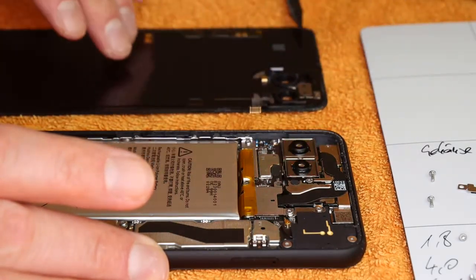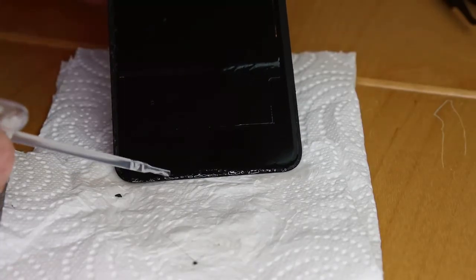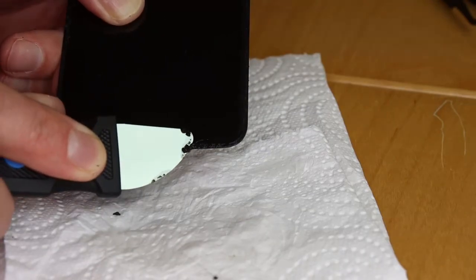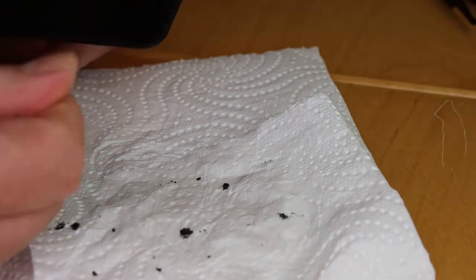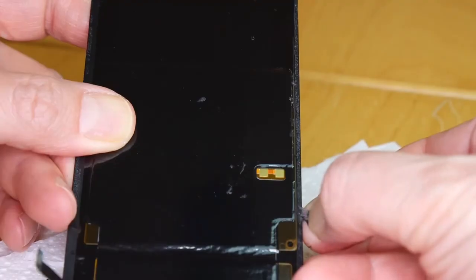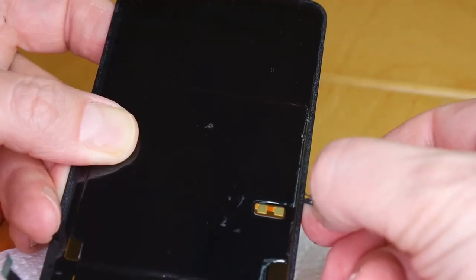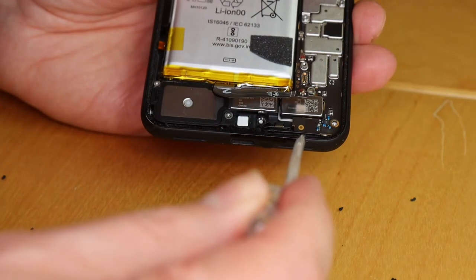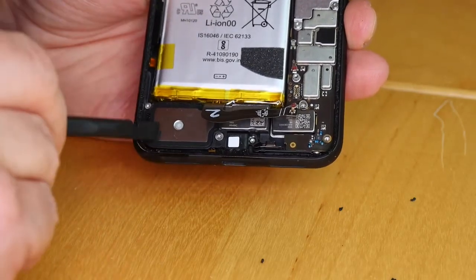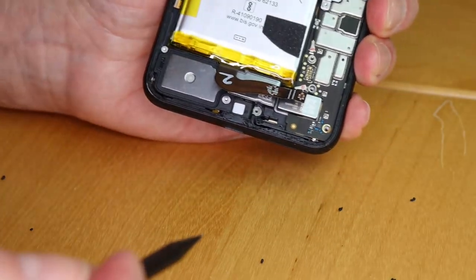So far, I have cut through the adhesive, but it is still on the parts. It's time for the isopropanol. I put it generously on the adhesive, let it sink in and rub on it with a spudger. This is quite tedious. I work along the edges of the back side. The alcohol affects the surface, so I continue without it, which makes it even more unnerving. And it's only half of the job. The stuff is also on the frame, which is made of metal, so alcohol can be used in heavy doses. This finally leads to a more or less complete removal of this gunk.